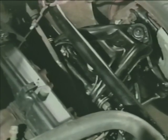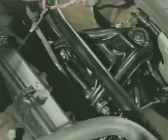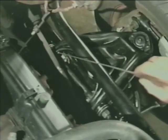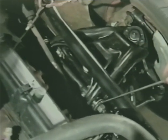Also, between each adjustment of the tie rods, we must resettle the front end back in to allow the adjustments to take effect. Before driving off, there are 6-point checklists you must run through. 1. Make sure that the upper control arm to chassis mounting points are tight. 2. That you did your final tightening on your upper control arm shaft nuts.